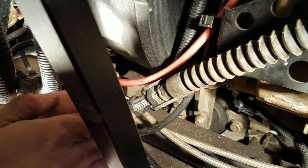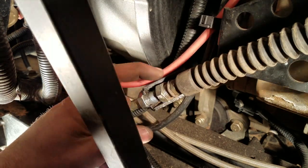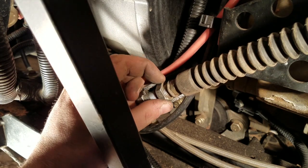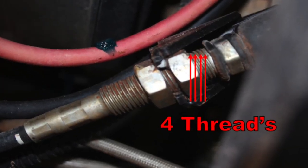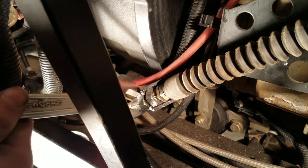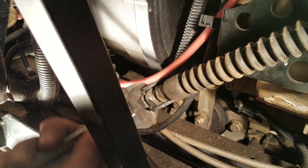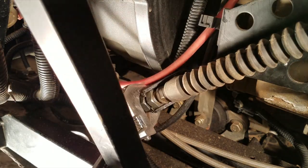With the correct shift cable, this final step went very smoothly. Just made sure to set the back nut with the same four threads visible between that back nut and the boot, and snugged up the front nut by hand, eventually tightening it with a Crescent wrench. Be sure to check for a video link in the description for a more in-depth look at adjusting the shift cable on your Razor.